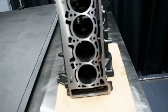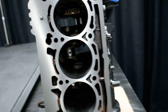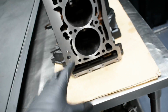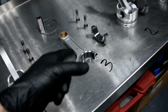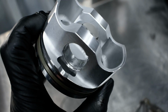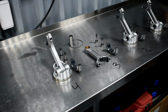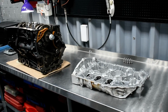Engine block is here. The engine block, I didn't wash it again. The oil jets down there, all in place. So, making the gap, putting the pistons, like I said, this is the number 3, and then stretching the ARP bolts. One C-clip, this one, it's in place already. From here it's missing, obviously, because I have to pass the wrist pin. Alright, we are looking good. Let's continue. Every time, same story, every single time.